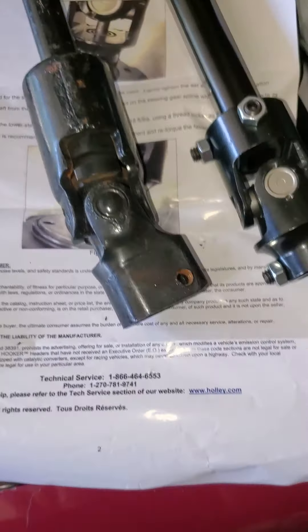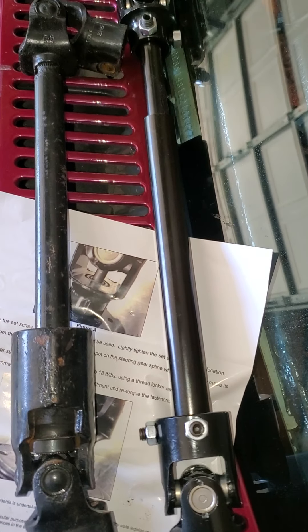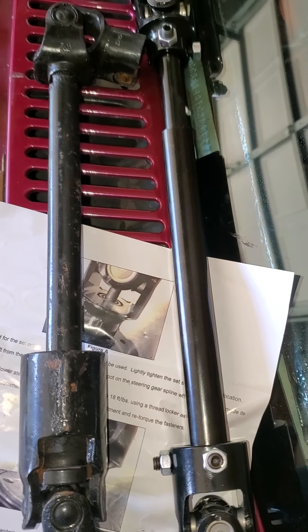Now you can see that gap — this thing turns that whole gap. So if your suspension is under a load and you go to turn the wheel, this whole thing's going to move. With u-joints there's no slop, there's no vibration dampening, so yes you're going to get some road feel into the steering wheel. But for a drag car, what does it matter? It's going to go straight — the steering is 100%. If you barely turn the wheel, it's barely going to turn the tire.